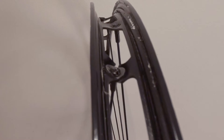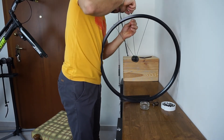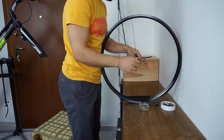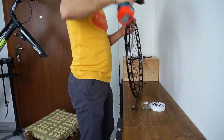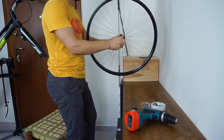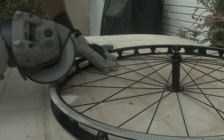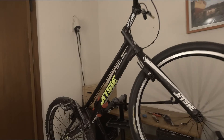As I told you before, I was really careful with the tension of the spokes around the damaged area, and so the wheel lasted about a month of training sessions before it started failing. Now it's time to rebuild the wheel. I followed the same principles I used when building my rear wheel — if you haven't watched my video on how to build the strongest wheel for trials, go watch it via the link in the description. For this wheel build I used nipple washers again to spread the tightening stresses around the spoke holes. I used the 26 DC front rim and the relevant spokes, following the same lacing pattern as before. After the initial tensioning, truing, and having made sure the wheel is perfectly dished, it was time to stress-relieve the wheel and go through the final tensioning and destressing cycle.